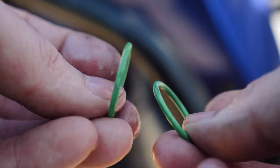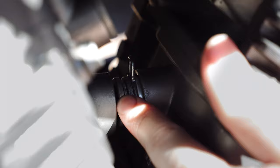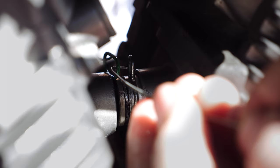I didn't buy the original o-rings because I got them from a friend who is a car mechanic. I can't tell you the size of them. Before putting them back I cleaned the area and lubricated with a little antifreeze liquid. After that I made two hooks of wire at each end — that's how I managed to put them in their place very easily.